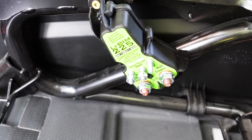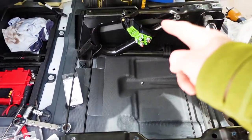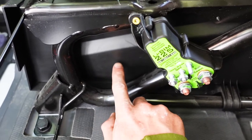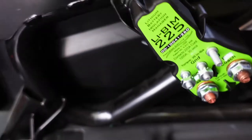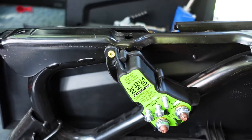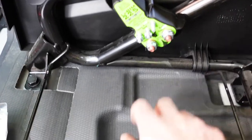I'm glad we don't have leather seats — that was heavy enough. We have our BIM mounted, and I chose to stick it on that side of the seat just because there are a lot of wires and junk over on this side, so less clutter over here. We'll be installing our switch right here and running it over to the signal terminal. We'll have a ground here and ground that out right here just to keep all the wires on this side, and ground our switch out there too.